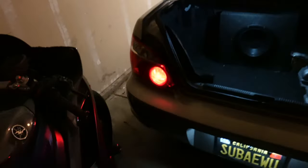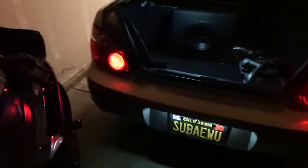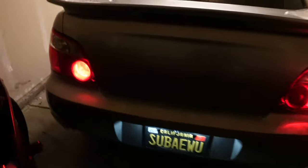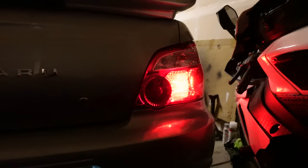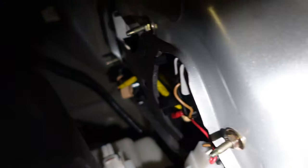There's one more thing for this video — a quick tutorial. If you've never seen how JDM tail lights are set up on the blob eyes in Japan, here's how it goes: you have your running light and brake lights. In the USDM setup it's running light, running light, brake. In the JDM setup you have two super bright brake lights and one smaller running light. I personally like the JDM setup a lot better — I think it looks a lot cleaner.